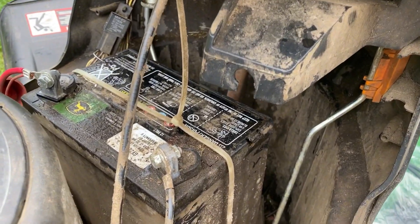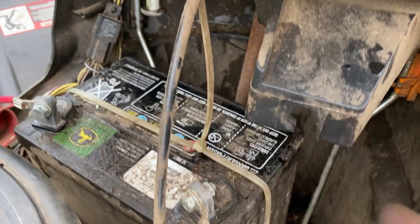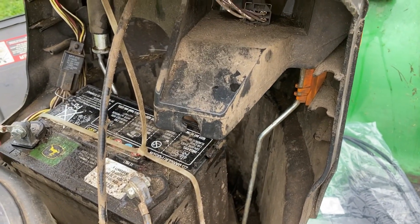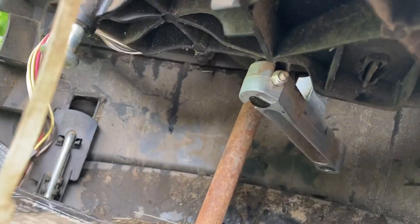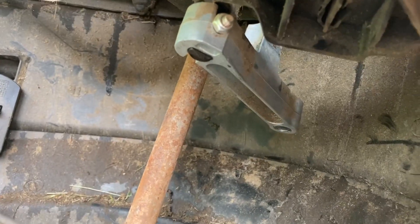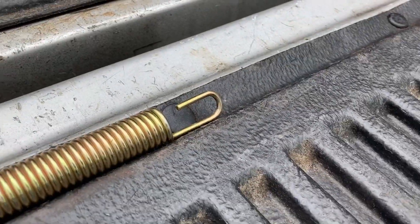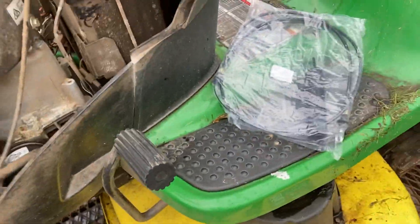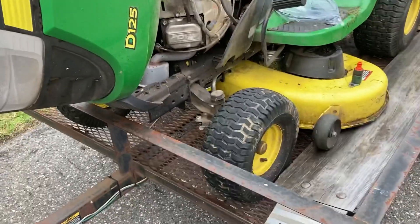When I tried to cycle that lever over it snapped that little piece. I'm going to see how this one fits — I may have to put a reinforcement plate on here with a couple of screws to hold it in so it doesn't come out. Basically you have a shoulder screw, a nylock nut, and they go on to the end of the linkage back there. On the end is where the eyelet goes and on the deck tensioner that's where that goes. I'm going to fish it underneath, get it on the deck, and hopefully when we try this thing out it's going to work.